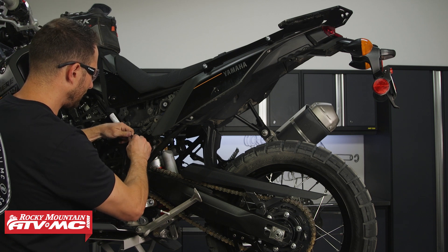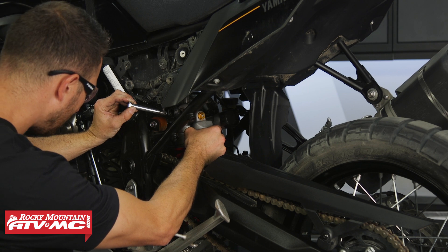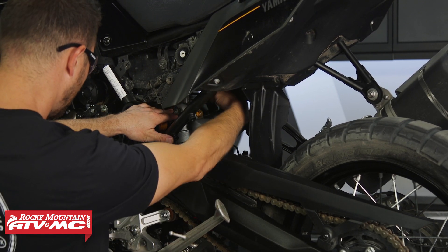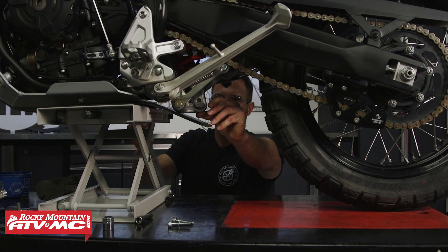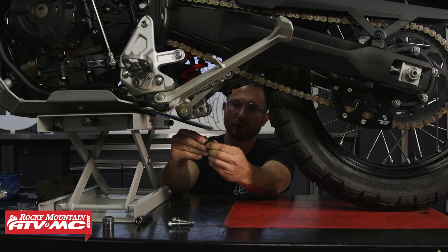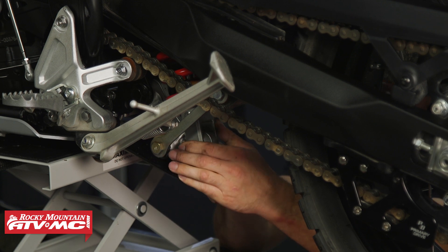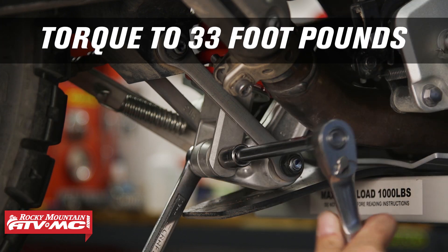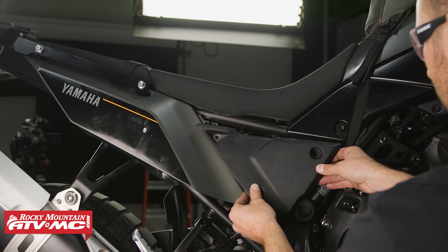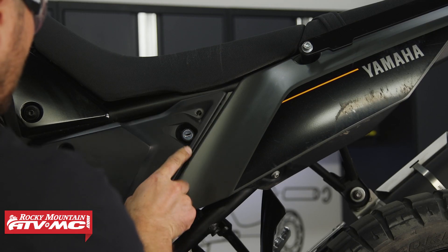For the mounting bolt I'm going to apply just a little bit of grease to prevent corrosion. We'll set the upper mounting bolt in place — there's a bracket on the other side you'll need to make sure you're lined up with. Now we can lower the jack down just a little bit until we can install that lower shock mounting bolt. I'm doing the same thing with that bolt, applying just a little bit of grease. Slide it through, then install the nuts. Both of these are going to get torqued to 33 foot-pounds. Then from here we'll reinstall the side covers, make sure you line up the grommet and tighten down the three bolts, then do the same thing on the other side and install that passenger peg.